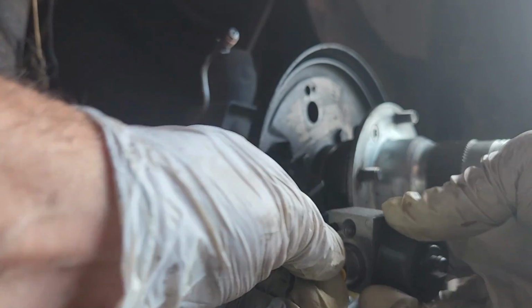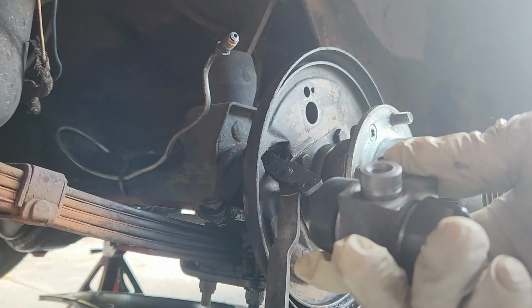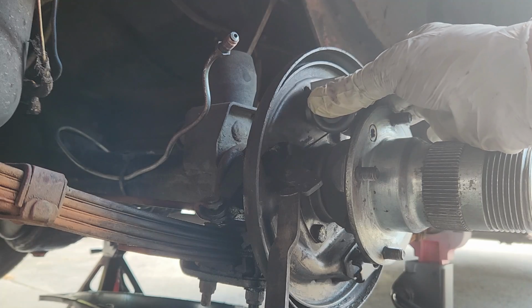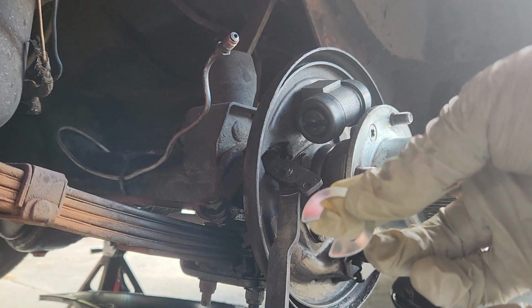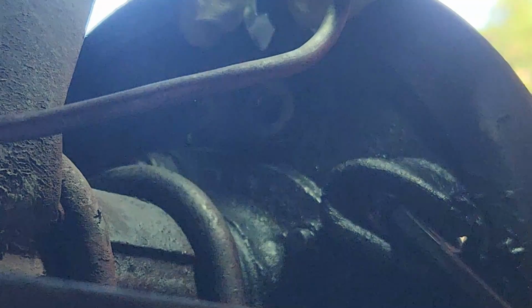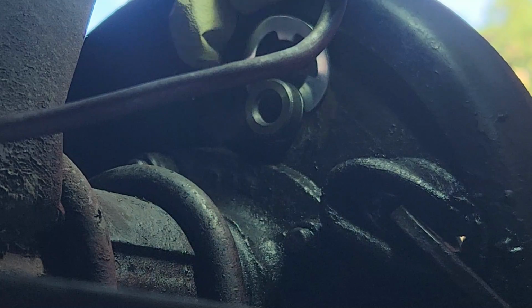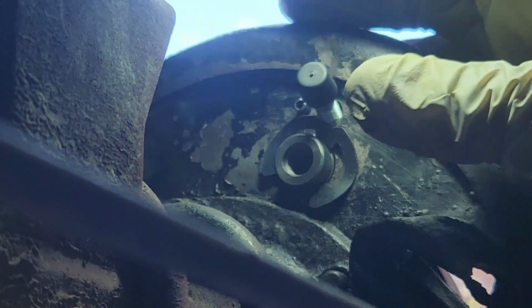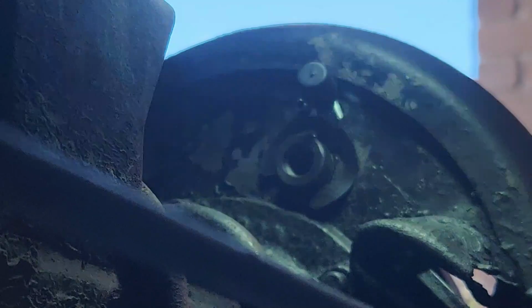Having removed the bleeder, we'll remove the protective cap, put it in place, and let's go around and put the circlip, which is the hard part. And after you put that, believe it or not, with a hammer, let's put the bleeder on. Tight it, and let's go for the shoes.